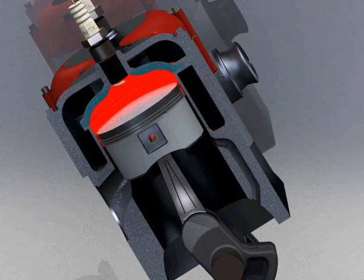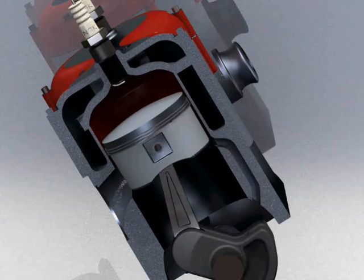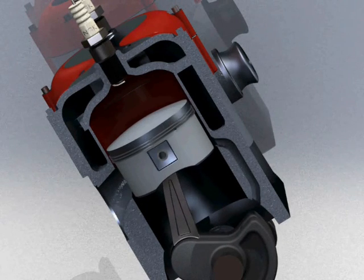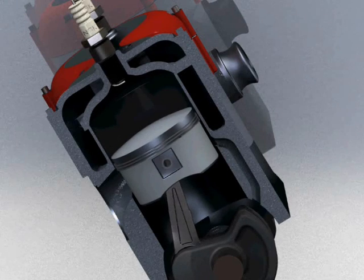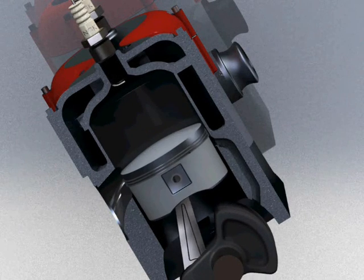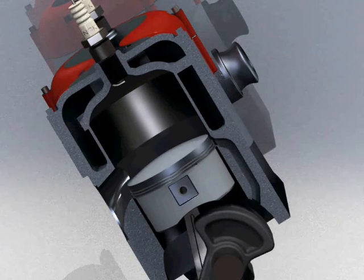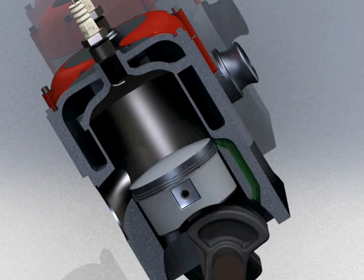This expansion is where the power comes from, and it forces the piston down until the exhaust port is uncovered. The high pressure of the ignited mixture causes it mostly to force itself into the lower pressure of the exhaust. A millisecond later, the transfer ports will open again, and this rush of new mixture exhausts virtually all the remainder.